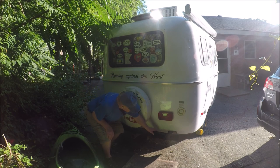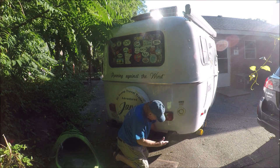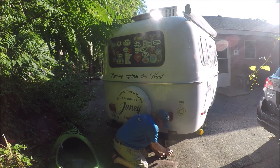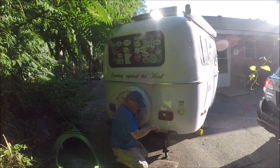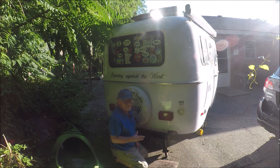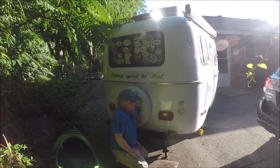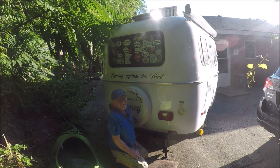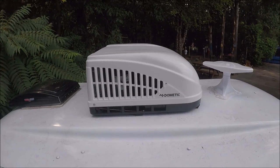To set the trailer up so it stays stable, you've got a leg on each side — pull it forward and then down. You push the leg down, and there's also a bar you can crank up to take pressure off the bearings on the wheels. I talked to other campers and to Orion up at Scamp parts — he said to repack your wheel bearings about every 5,000 miles. I put 20,000 miles on before repacking mine the first time, which I wouldn't recommend.